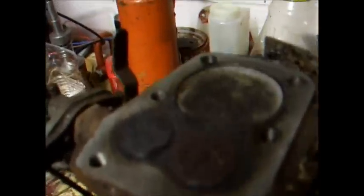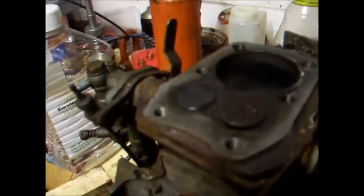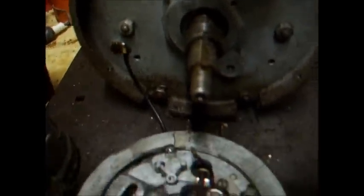It's had a lengthy working life. It's stamped 20 over on the barrel and is also stamped 20 over on the piston. So she's been bored out. So yeah, definitely had some work done to her. Got plenty of numbers and serial numbers to check out. It may not even be a 2A like I think it is, who knows.